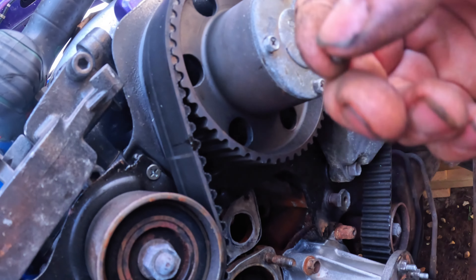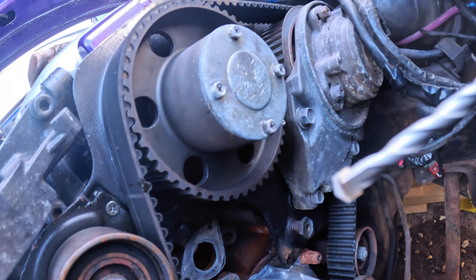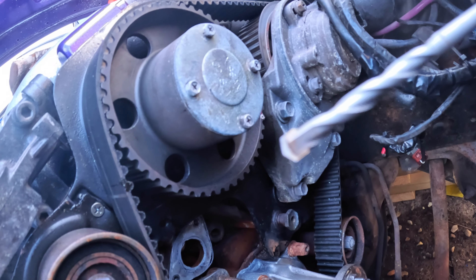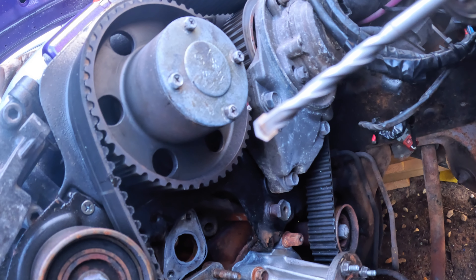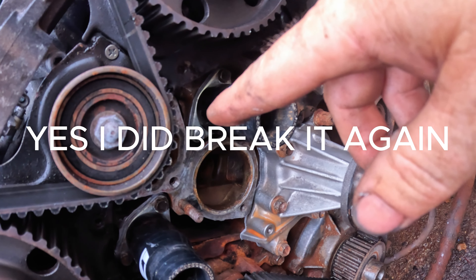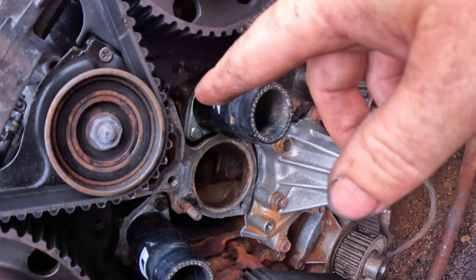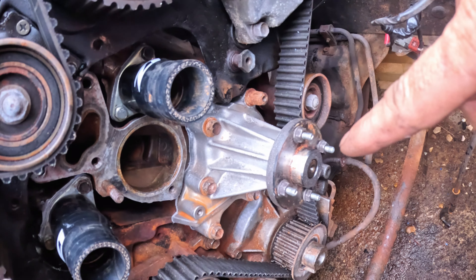I've been very lucky to get that bolt out. I tried to drill into it, then found a cement bit that works like a screwdriver. I put it in reverse, hit it very fast, and it spun just enough to get pliers on it. I've reinstalled it but need to wait another hour before snugging it up again. I found a replacement bolt - same length, same thread - and whilst waiting I'm going to put the lower timing cover on.